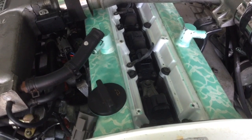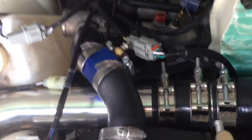So it turns out that I have an RB20 Series 2, but I have an RB20 Series 1 wiring harness set up. So that's why the coils won't connect, the throttle position sensor, the CAS sensor, the engine temp sensor, and one other sensor under there. I think it's the idle control valve or the air regulator sensor. Now guess what I gotta do? Yes, cut and solder. Sucks. It is what it is.